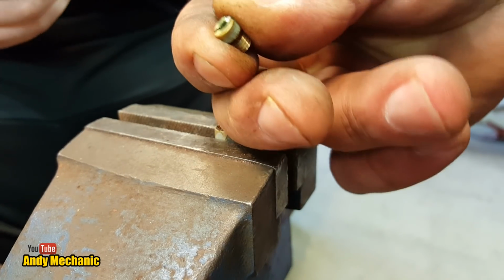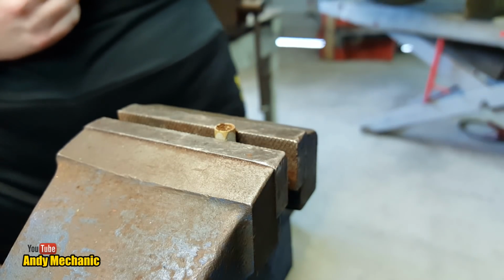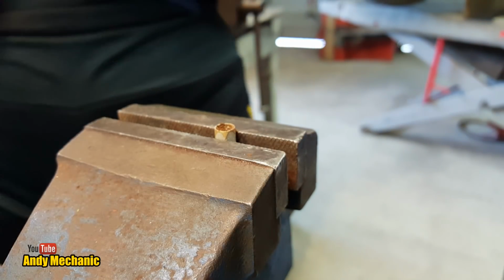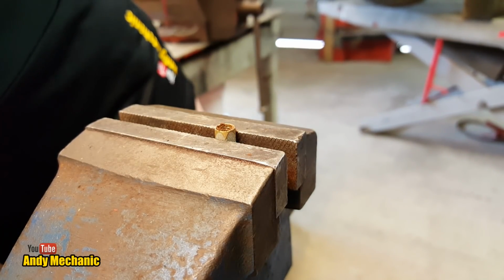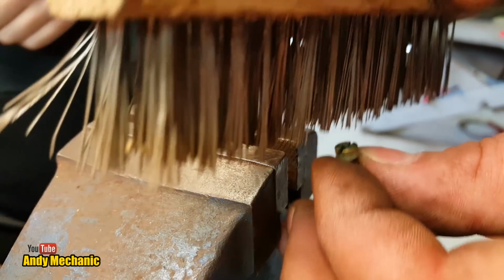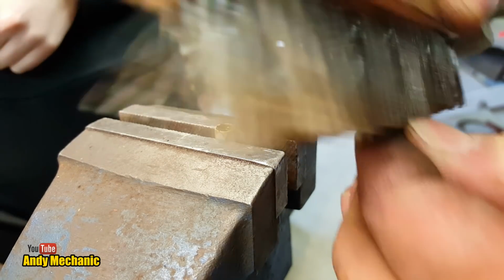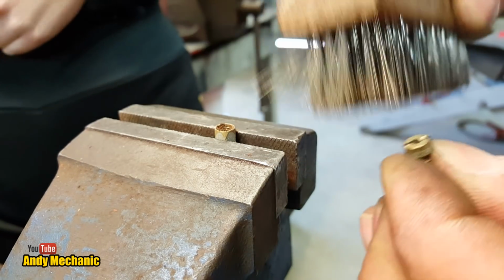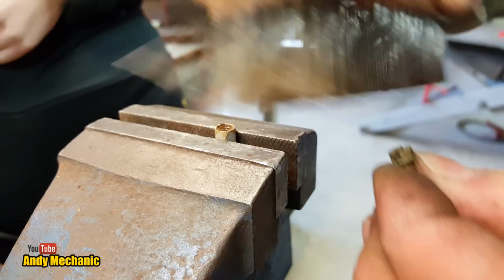Now, from memory, there's two jets. There's a 95. Just pass that wooden wire brush over there, if you can. The wooden one's a lot better because the plastic one's knackered. Now, I think 95 is the standard, and they do a 90 for high altitude. Over 5,000. God, I read the manual this morning. Over 5,000 feet. Not meters, but feet.